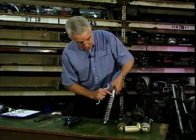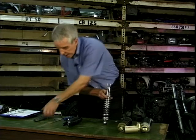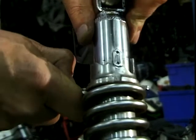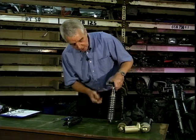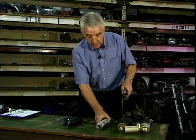I'll turn it upside down so you can see the cam arrangement. Put your C-spanner on — I need to block this here so it doesn't turn — and just turn that round. One... two... and so it goes. I won't do any more because it's very difficult on the bench, but that is compressing your spring.